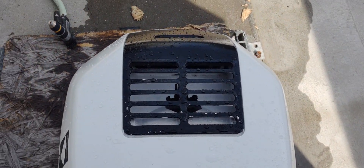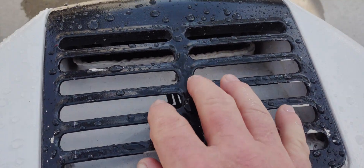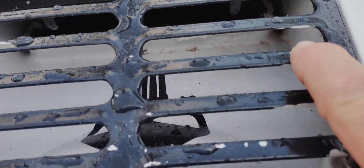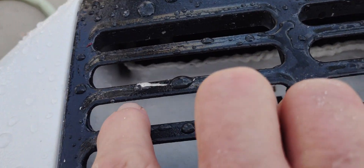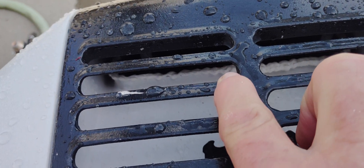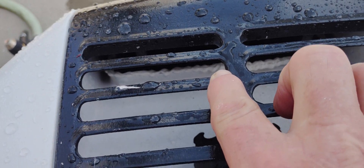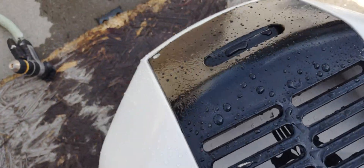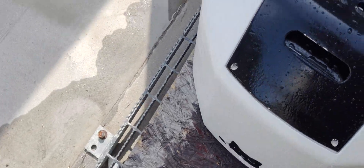I'll show you here — this one I just drilled out. I've done it on a couple of other ones and figured I'd do it on this one too. Once you get rain to pour in on the snorkel, it's supposed to build up and settle here. It has two small exit areas on the back side and over here where the water runs out. It's not supposed to get any higher than the lip of the snorkel. The rain falls in, runs out that side, runs out that side. But over a period of time on the back side, you start getting trash and junk — you've repainted it three or four times.